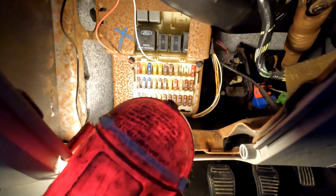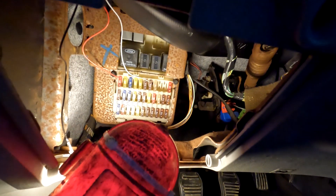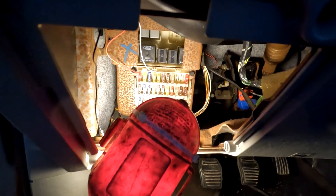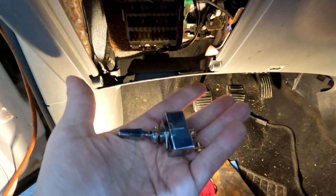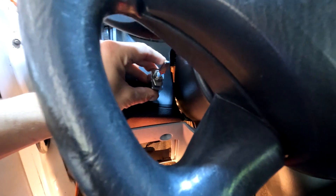To power the tach I drilled a little hole right here. So now we're under the dash — I've got the white and red wires going into the fuse box to actually power the tach. You still need a switch because the dash light switch is downstream in the fuse box. So I've got a switch here, which was only $8 on Amazon — I'll put that link down below too. And I think we're going to be able to mount it right here next to the steering wheel.